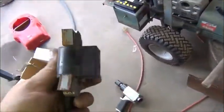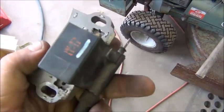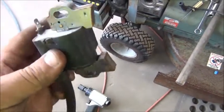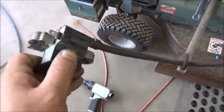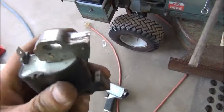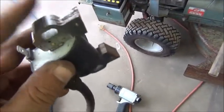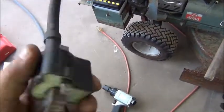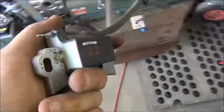Now the next problem I had was that there was no spark. So I dug in and pulled the cable of the coil out and found it's got a lovely crack all the way through it - it's well and truly stuffed. Kind of reminds me of a little flyback transformer actually. Well, I know an ignition coil is just a flyback, but we're using the magnetism from the magnet in the flywheel to create a magnetic field in the iron core, which then excites the coils inside when the field collapses. So that's interesting - I never thought they'd be designed like that but they are.